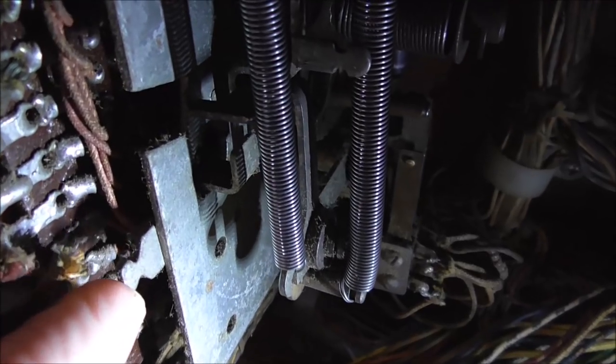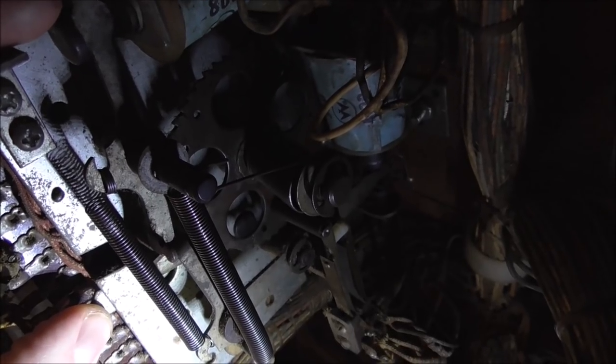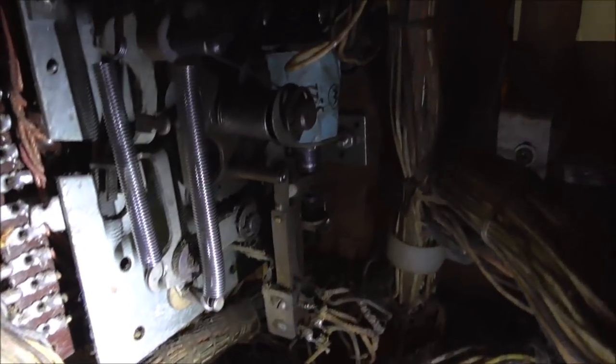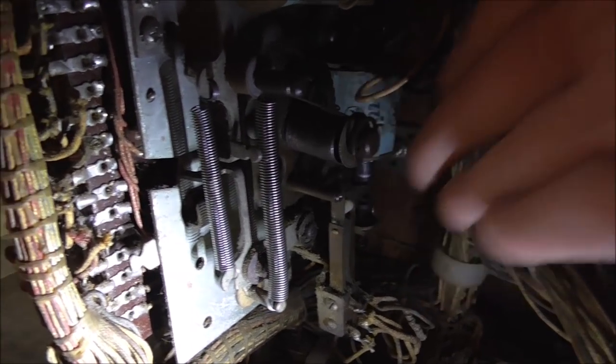So this little piece is in here that raises up a little bar, right, on a spring. And when this pulls in, that little bar should pull up to where it can no longer go in, so that it does freewheel back to the beginning, which will allow it to go all the way back, right? And then as soon as this one pulls in, it's going to allow those to re-engage with the gear, right? So I need a spring.